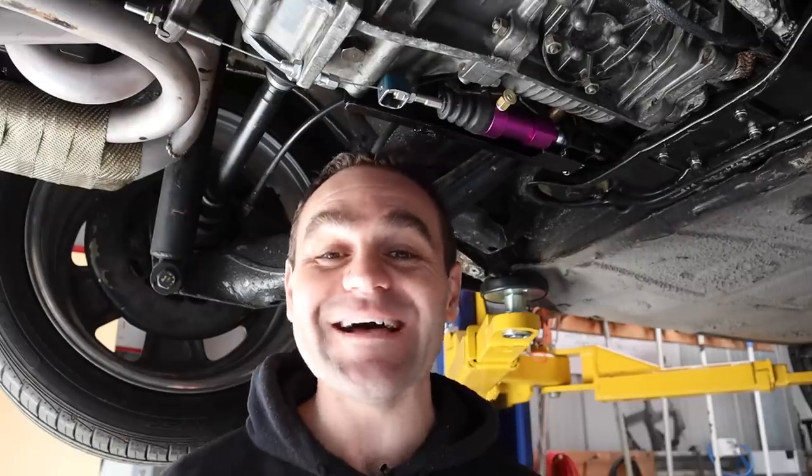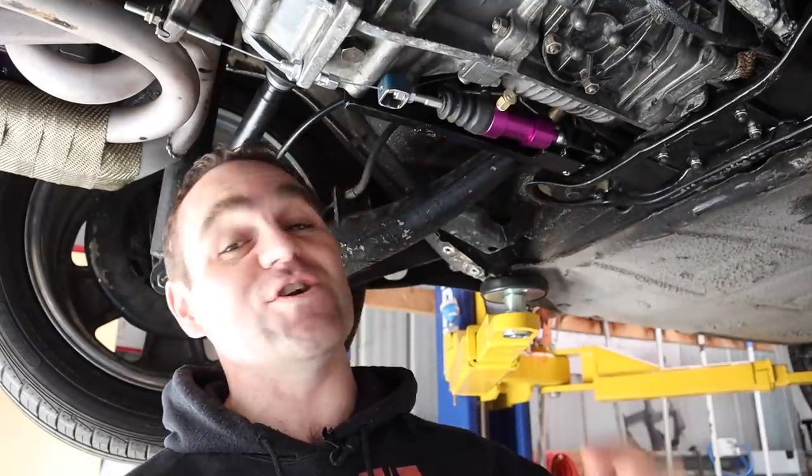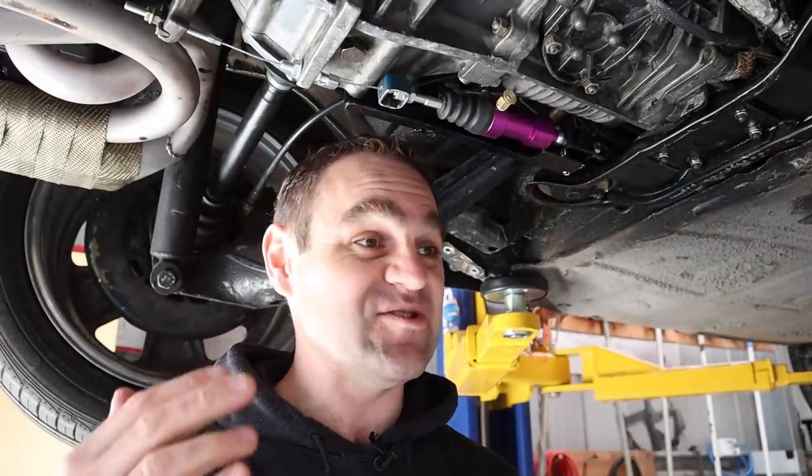So a lot of you last week will have seen that I started my hydraulic clutch conversion on this car, and I was stumped by my imperial tube nut that I need to fit into this master cylinder. There just hasn't been any cars in Australia that I know of that have been made with those fittings for at least 20 years, so you just can't find them in a wreckers anymore. But I managed to get them so we can get that part sorted.